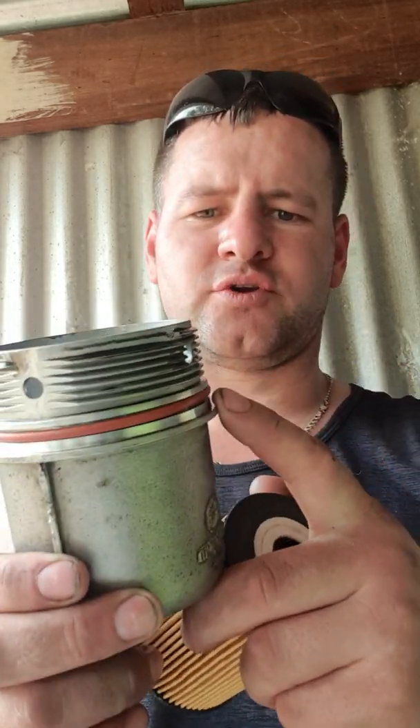Replacing the oil filter — I've removed the oil from the plastic housing. They always come with a new seal, so always put a new seal in if it comes with the filter. I made the mistake of putting the old seal back in and it leaked, so I've done that once and once only. Take that orange piece and put it back in there — there's a little circle piece in the bottom, push it in and it should lock in.